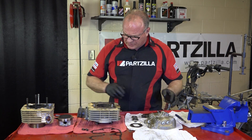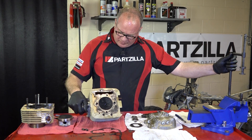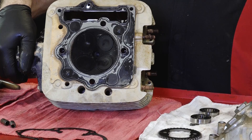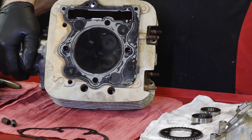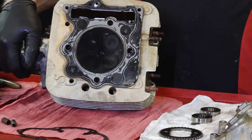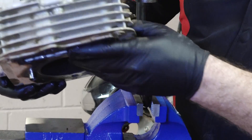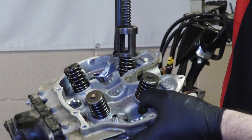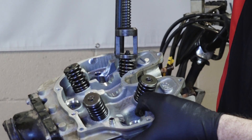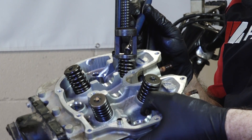What we're going to do next is go ahead and take our head and put it up inside where this vise is holding our valve spring compressor, and we're going to pull those valves out and take a look at the seats and the seals on the valve stems. Each valve has a little bit of an indentation in the middle and we're going to compress that spring, which will bring out the keepers on either side of the valve.